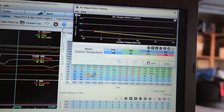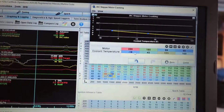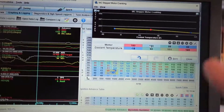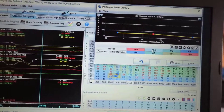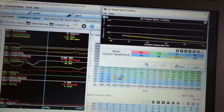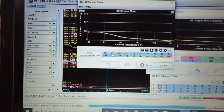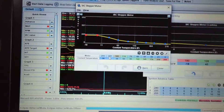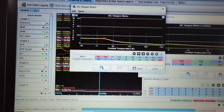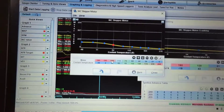255 is too much on the startup stepper, so I'm going to change it to 180 — that's why the car goes to 2500 RPM when it's too cold. I'm going to set 180, then 120, then probably 80, and then 60. I don't think 255 is good at all, so I'll change it to 180 and then 160 and so on.